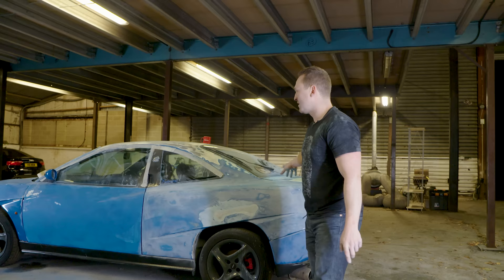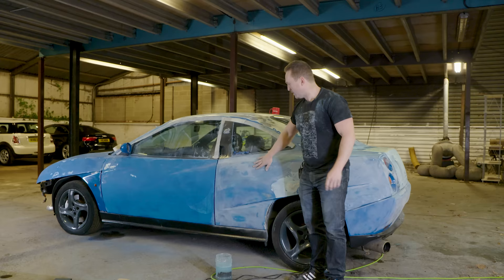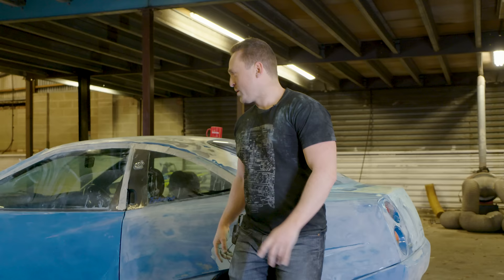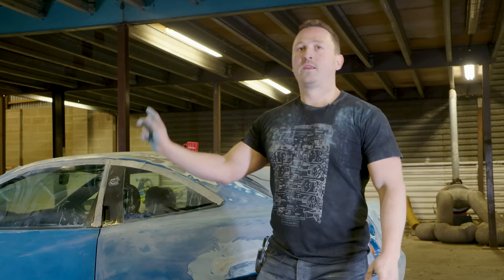It is now the end of day one doing a DIY respray with rattle cans. We haven't actually got to that. What we have done is we've flattened off all the paint. You can see the difference here — this is thicker than this. The roof — bit of an accident. We were using Rory's sander. It's too aggressive. Anyway, tomorrow we're going to go back, we're going to wet sand it and then we're going to primer, and then we're going to respray everything and then clear coat.